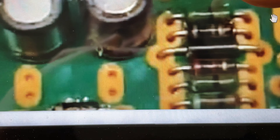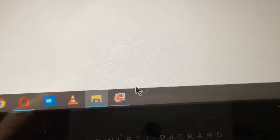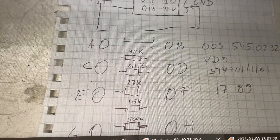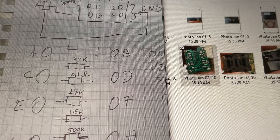If you want to verify your unit is working, those are the resistor values you need. The 0.1 ohm resistor can get damaged. It's used instead of a jumper wire — back in the 60s through 80s, the Japanese used single-sided boards with jumper wires. Bosch/Bosch-Videc used 1% metal film resistors for accuracy and longevity, and decided to use 0.1 ohm resistors which also serve as fuses.